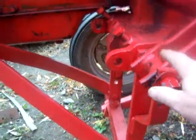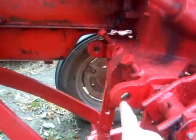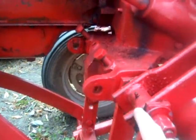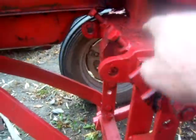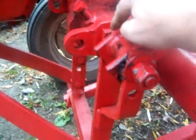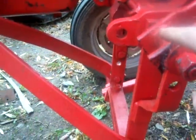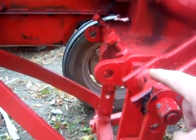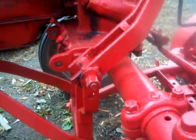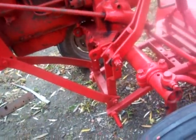This arm here and the through bolt — I had them going through these ears over here, which is wrong. It seemed like the right thing to do, two ears on each side, but it was wrong. I had the long bolt going through the whole case. It's actually square here — you've got to use some square stock, drill the holes, fit the bolt, and that's where it goes through. Not through those ears. I just wanted to say that so anyone who watched that first video won't copy my mistake. That's really the main reason I'm making this video — to clarify one of the things I did wrong.